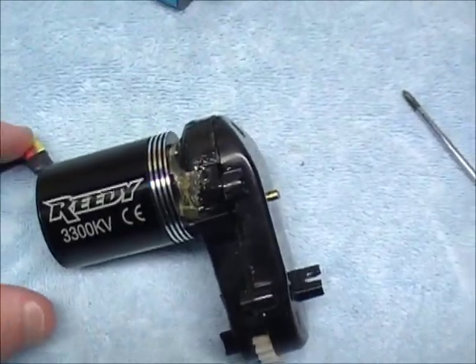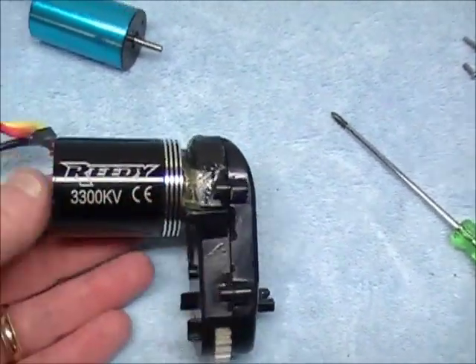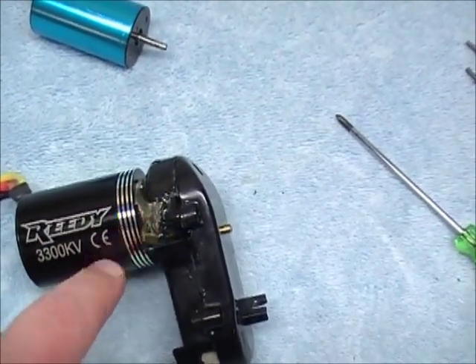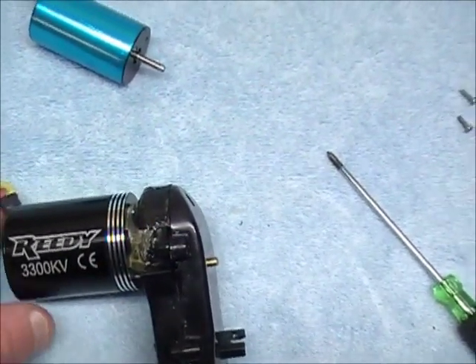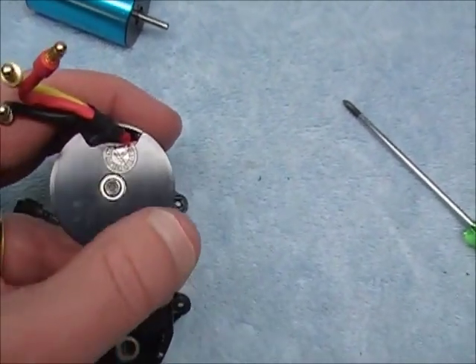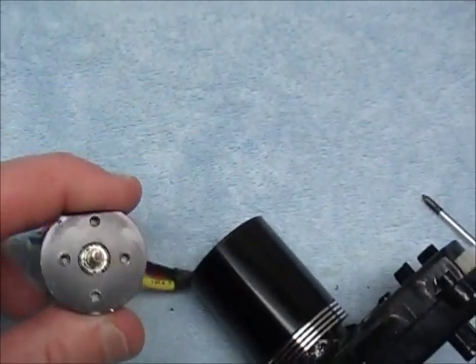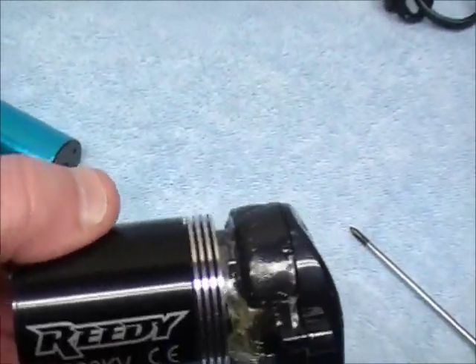In order to mount this 36-millimeter motor onto the stock drivetrain, I actually had to drill and tap new holes into the motor. They're 3-millimeter tap holes, basically 10 millimeters from the outside diameter inwards — to match where those holes are on the smaller motor.